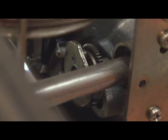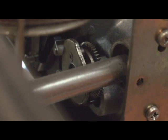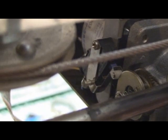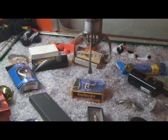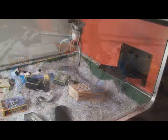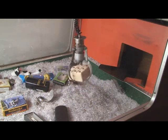There's actually a pretty simple trick to this. On most newer cranes, when the claw drops and touches the floor or the prize, the tension in the string on which the claw hangs starts to loosen and that triggers the reversal of the motor, and the claw starts to go back up. On this crane, the claw starts to go back up when this gear makes a full circle — the lobe triggers the switch — meaning the claw can only go down to a certain point. The reason I was unable to retrieve the lighter box is because it was lower than the lowest point the claw can drop, so when the claw closes, it's unable to get a good grip under the prize. The heavier box was sitting higher, so I had absolutely no trouble picking that up.